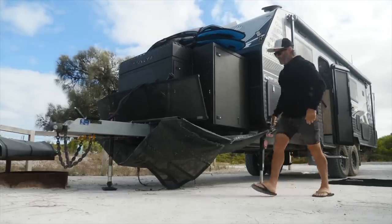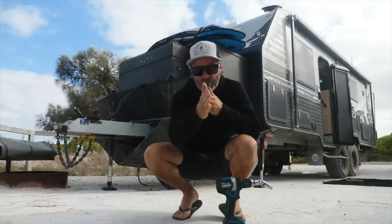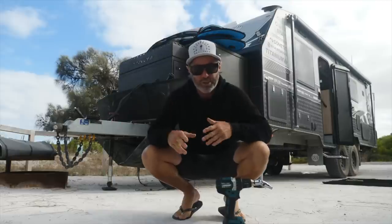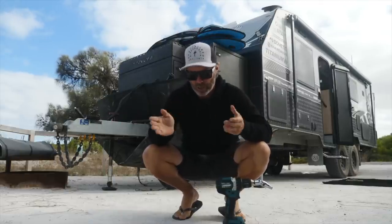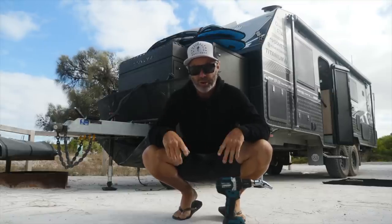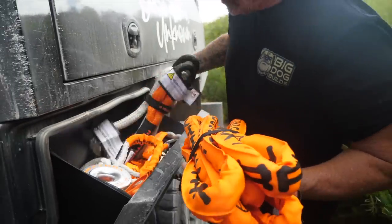There's the wheel straightening - did you see the van just move? When you get a dual-axle caravan into really tight positions and keep maneuvering, the tires tend to twist opposite each other. As soon as you take that pressure off and re-straighten the wheel, just be very mindful and careful of those situations, especially when you're unhitching in a tight spot with the car at 45 degrees to the van - when it unhitches, the van's going to move.